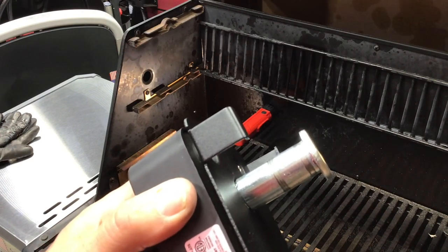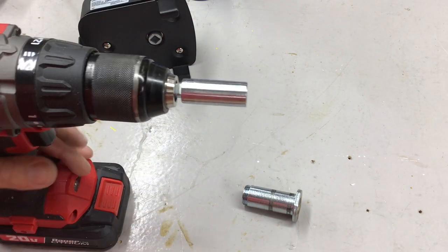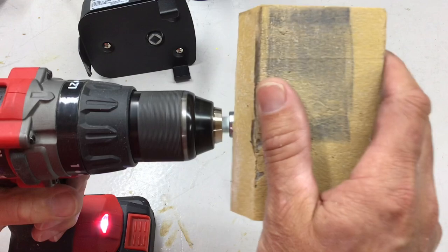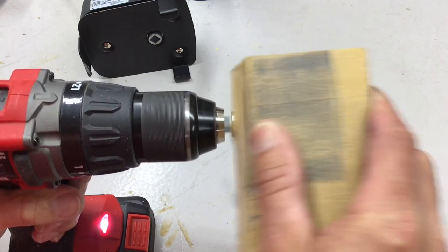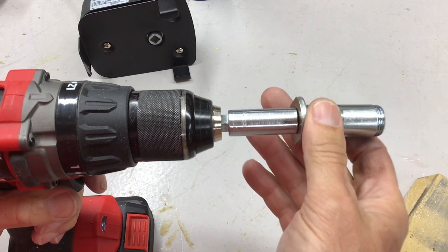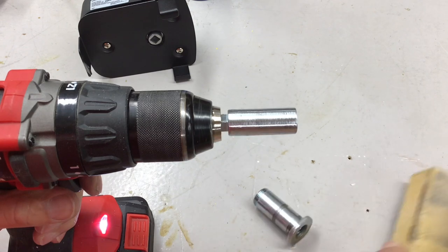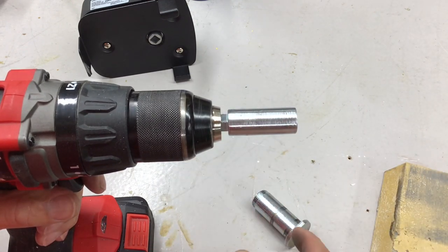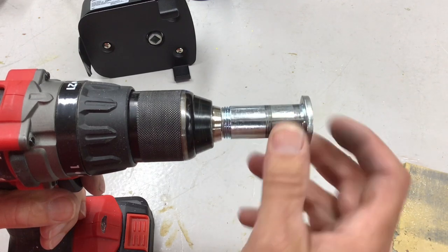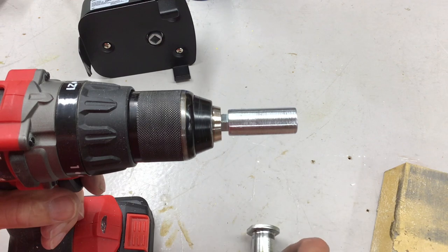I took that inside collar off and had some burrs on there. I've been using my cordless drill like a lathe — got it chucked up in there — and using a sanding block with even pressure. I don't want to take a lot off, just get that burr off and take enough so it fits into the collar without any issues. I'm using sandpaper so I don't get overly aggressive. Also, people putting oil in there need to be careful — this whole part is exposed inside the grill. It will get warm, and you could get fumes from that going into your food, so I'd advise against it.